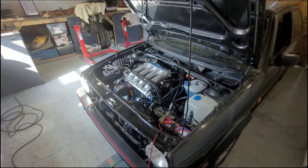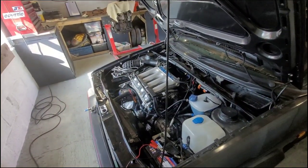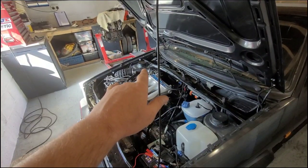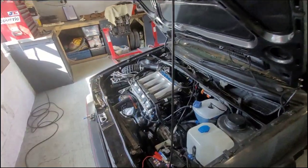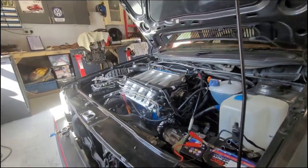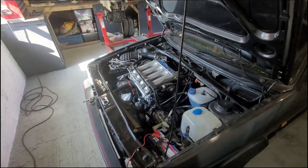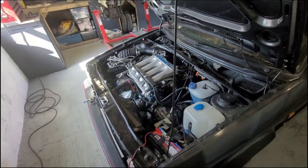So, as we've just heard, the engine's back together and it's running beautifully. The misfire's gone. Yes, a little bit hunty, but now we just need to get a CO meter and tweak the idle and CO2. Problem was the metering head. Now, I spoke to someone who's been tuning these cars since he left college, Mr. Tom Walker. He used to work at TSR, now runs a very successful retro resource, which this will be going down to on a rolling road for him to tweak and make sure it's putting out some good power.